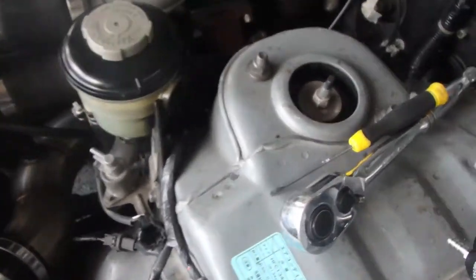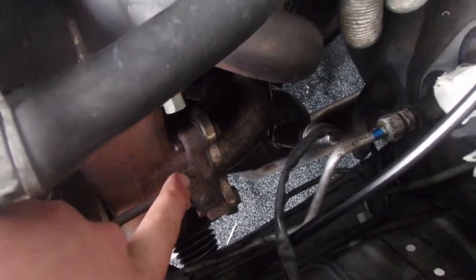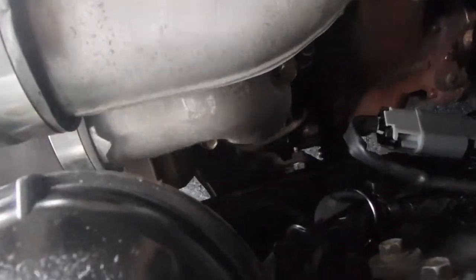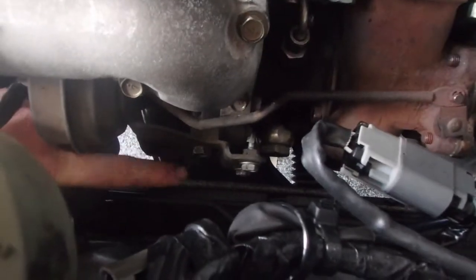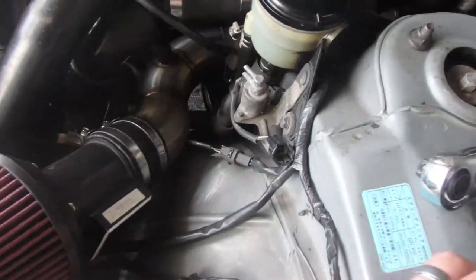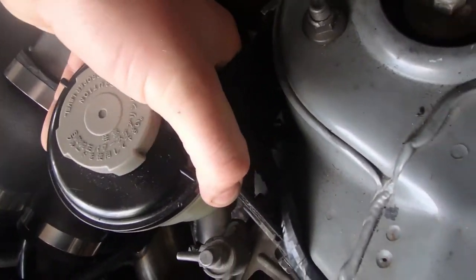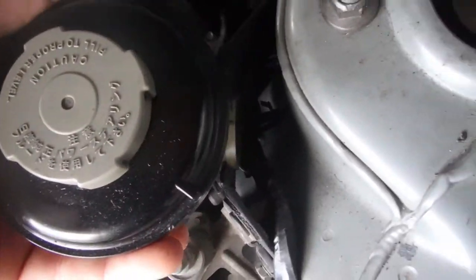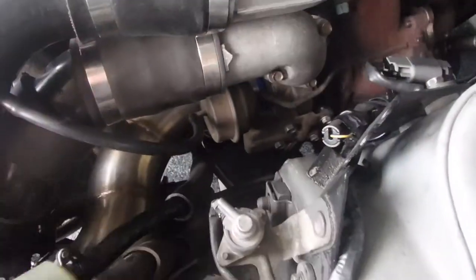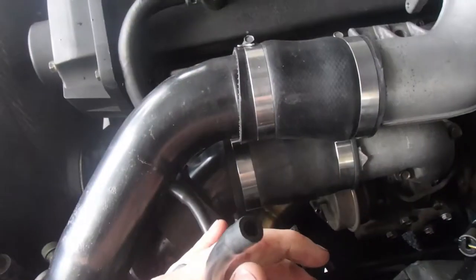The tools you're going to need is just a little flat blade screwdriver to get the little circlip off just here, and a 13mm socket to get the nuts off. First of all, you're probably going to want to get the power steering reservoir out of the way. I've got the reservoir out of the way — you don't want to pull your vac line off. Whatever you do, do not lose that circlip because the new gate does not come with one.